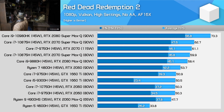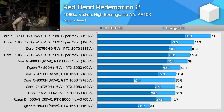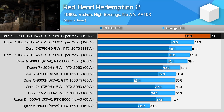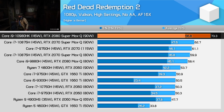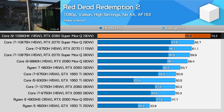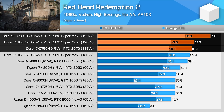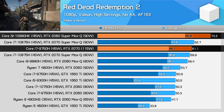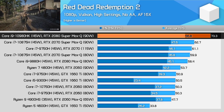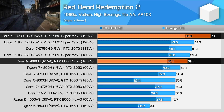Starting with Red Dead Redemption 2, one of the more graphically intensive titles in our benchmark suite. Using 1080p high settings, the RTX 2080 Super Max-Q is the fastest GPU we've come across so far, although we are yet to test Max-P variants of the new Super GPU variants. This GPU is capable of very playable frame rates, delivering 17% more performance at 90 watts than the 2070 Super Max-Q, and 20% more performance than the RTX 2070 configured at 115 watts. The 2080 Super Max-Q is a decent 25% ahead of the older 2080 Max-Q at 80 watts.